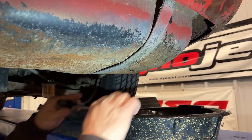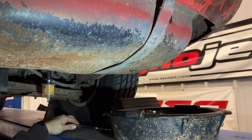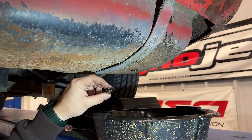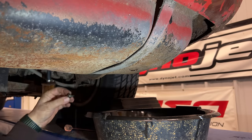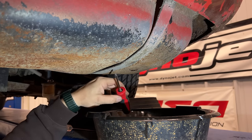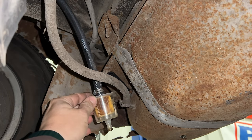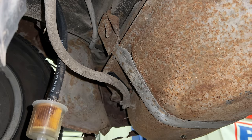The first thing I want to do is try to drain the gas tank. I'm surprised the plug wasn't worse than that — nothing came out. You can see there's some black stuff on the plug there, so I wonder if that is completely plugged. Either it's already all drained out, like I might have already drained the tank and forgot about it. The line coming out of the tank is already disconnected because I was using the fuel bottle to run the car before. Now I need to take off the return line. That hose is really old and rotten.